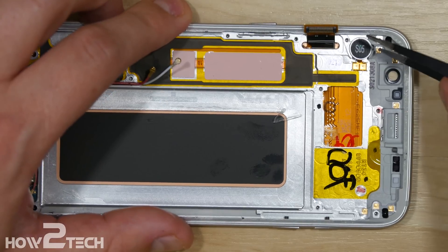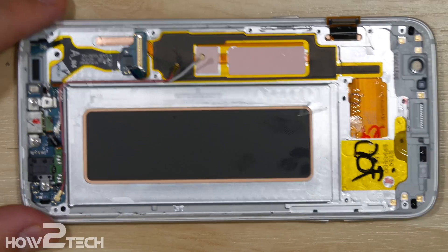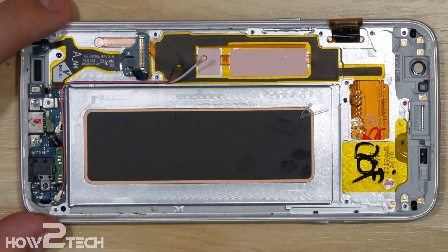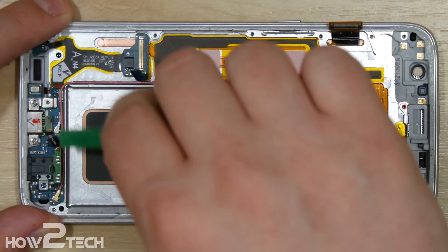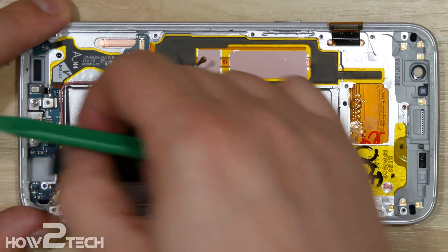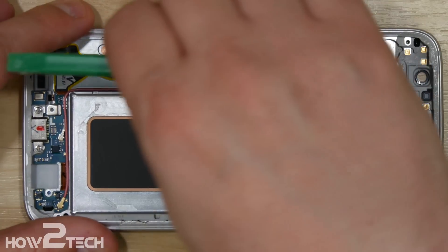Let's go ahead and pop out the vibration module. There's a little opening up here at the top — putting your tweezer in and pulling up should let it pop right out. We can also remove the headphone jack by removing the single screw that's holding it in place. Then using a spudger, pry up against the back of the headphone jack and down towards the corner, and it will go ahead and remove for you. We do want to undo the ribbon cable connection also. There's a little grounding connection on it as well, so in reassembly make sure that's put back in touching the middle frame. We can also remove the two wire cable connections.